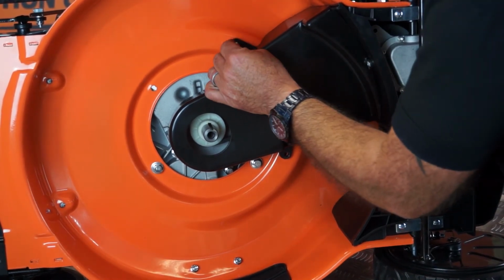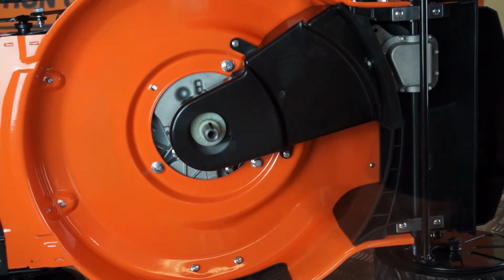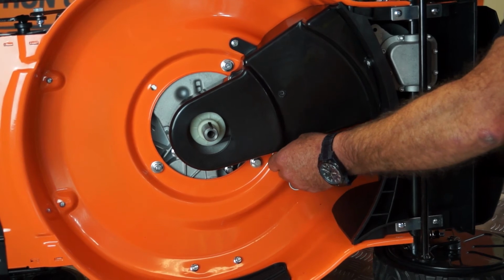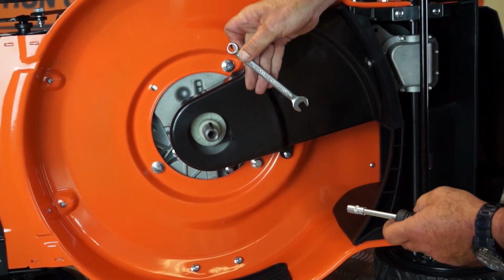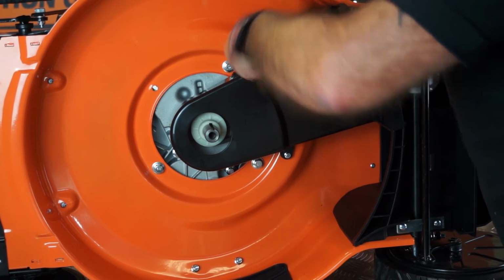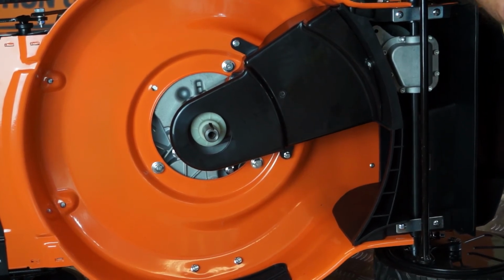Now I'll place a bolt through the top hole, one of the two bolts. Just loosely do up on the back side a little nylock nut till it's finger tight. So exactly the same with the bottom one. Put the bolt in the hole and just screw the nut on the top until it's finger tight. So back on with my 10mm spanner, just holding the nut from above and tighten this one up. That's that one done, and exactly the same on the bottom.